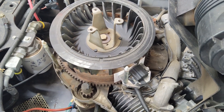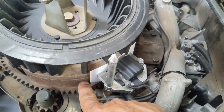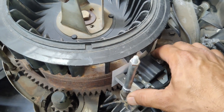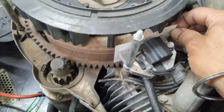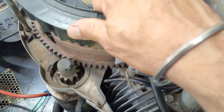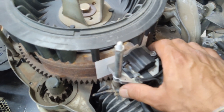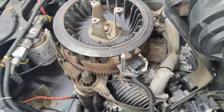I'm going to set the gap to around 11 thousandths. You can use feeler gauges or another tool, but I'm just going to use a business card here. Place it between the flywheel and the ignition coil, push the coil in, and rotate it at the same time to make sure nothing is scraping. It doesn't have to be exact — that's why you have a range of 8 to 16 thousandths. Get it as close as you can, then go ahead and tighten up the ignition coil in place.